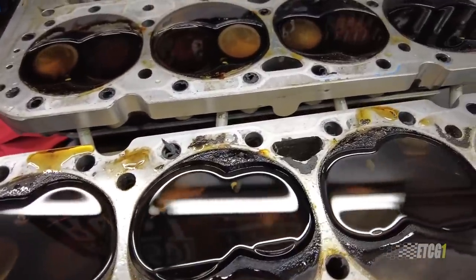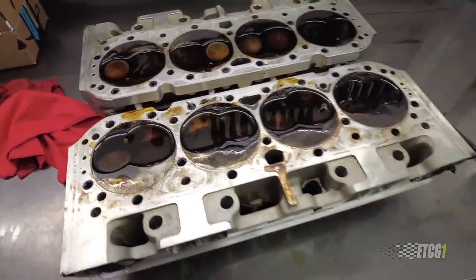I'm very happy to report that none of the intake valves were bent despite coming in contact with the tops of some of the pistons. I soaked the cylinder heads overnight with solvent to look for any bent valves — that's a quick, easy technique. If there is a bent valve and it is leaking, when you fill it with solvent, that solvent will leak past the bent valve and get down inside an intake runner or exhaust runner.